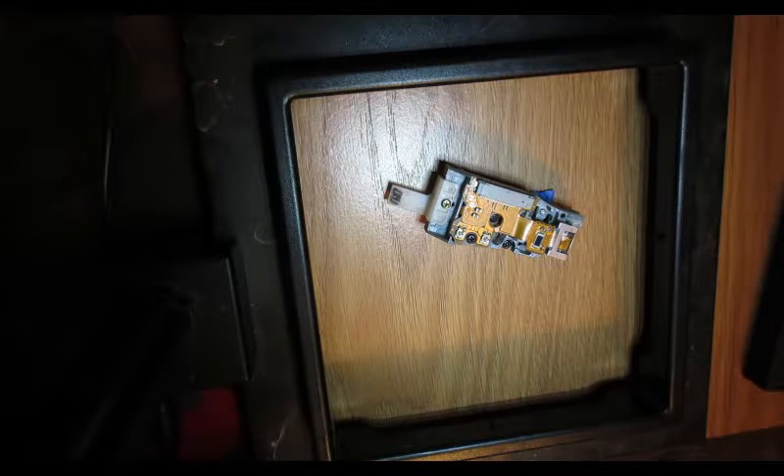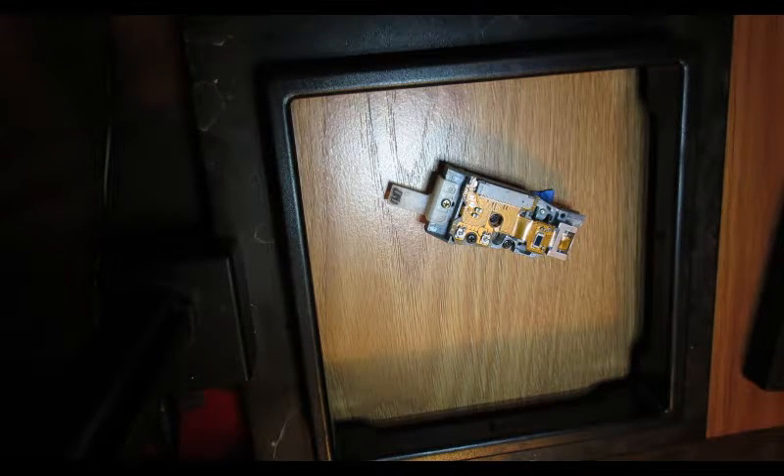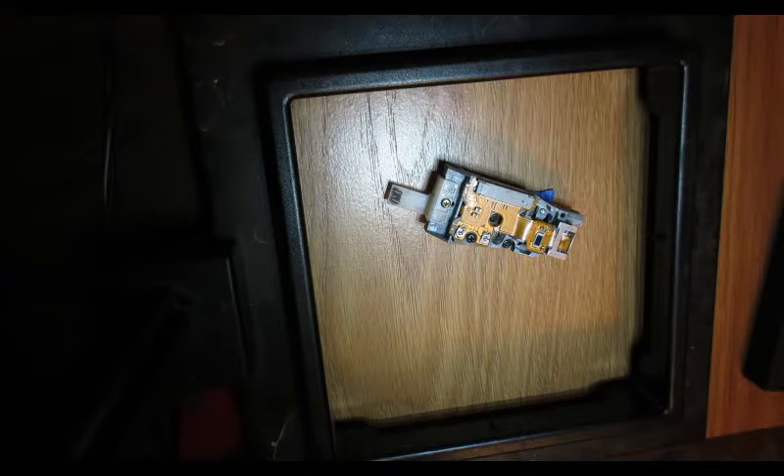Obviously if you're looking into adjusting the PS2 laser, you already know how to take it apart. If you don't, my soft mod video shows one being taken apart. This is how you fix it — if it doesn't work, you can keep tuning it down a little bit at a time. Do not go below 2.5 ohms or you will fry your laser. If that happens, all you have to do is buy a replacement laser — not that bad. Thanks for watching, subscribe for more, and stay tuned.